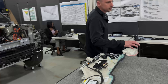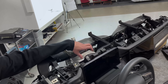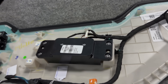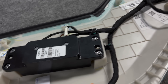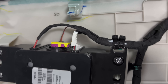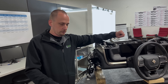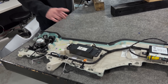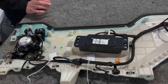This ends up residing just above the cluster. In the event of a collision, it will cut 12-volt power to the entire vehicle — all the batteries die, everything is dead. It will de-energize the contactors, making them open, which cuts high voltage power and makes it safer for first responders to approach the vehicle after a collision, so there's little to no chance of a short circuit. When we see these in other vehicles — typically the Germans — they'll put them either right on top of the 12-volt battery or very close to it, which minimizes the route that power has to flow through rather than coming all the way up through the IP. The other benefit to that German execution is it's much more serviceable.